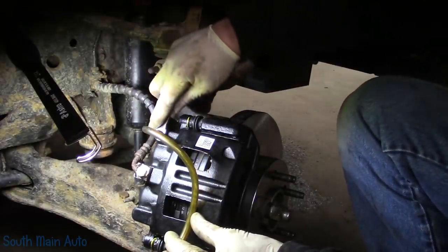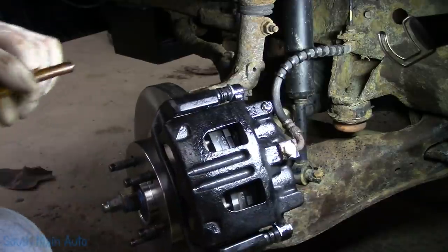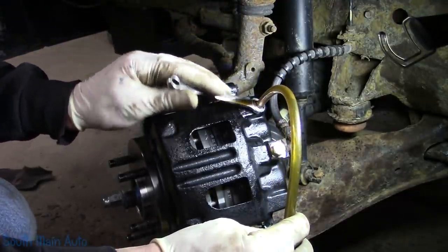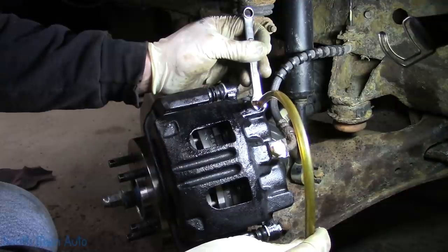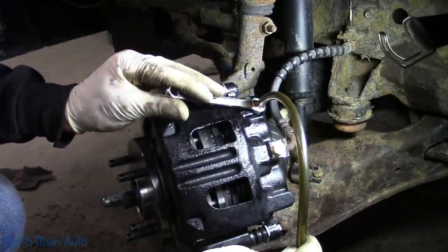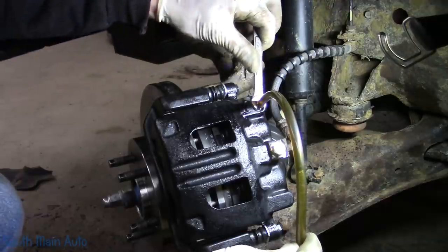All right, we're in good shape on this side. You got up, we'll do the other side real quick. Turn your wheel to the other left. That's good. All right, you're up, right? I am. Okay, down. Up. Okay, down. Up. Okay, start pumping them up. All right, is the pedal getting a little stiffer? Uh-huh. Okay, down. Up. Down. Up. Down.